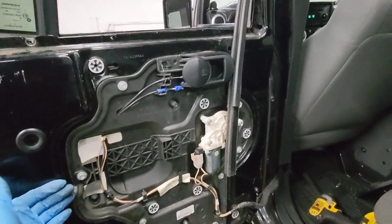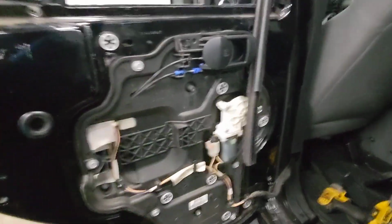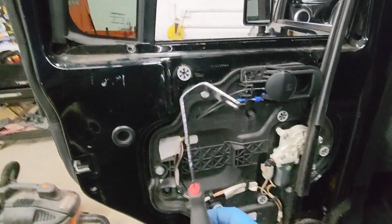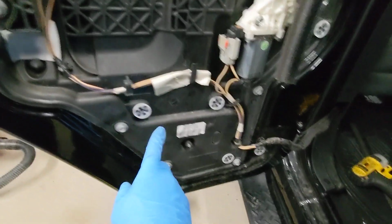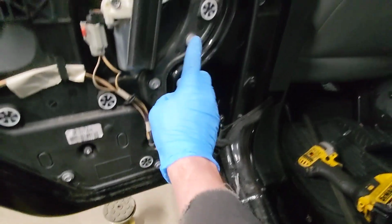So you got to remove the panel itself, and we used the panel popper tool that had a little bit of leverage built into it, and where these little star guys are is where the locations of the pins that actually hold the plastic panel into place.